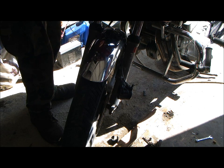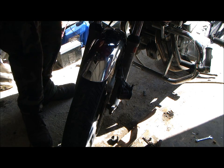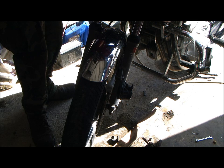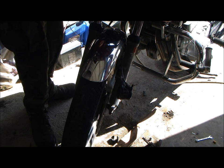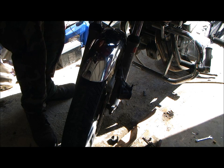And while I'm up here, there's two little holes in this master cylinder. One of them is the return hole. I'm going to blow them both free as I can while I'm up here filling this thing. Most of y'all California people are going to be worried about, oh man, you should have gloves on. You know what? I don't care if the stuff is known to the state of California to cause cancer. I already got it. I don't need to worry about it. I'm blowing directly into those passages, by the way.